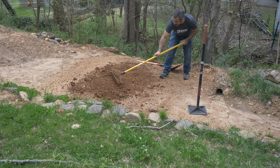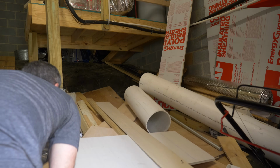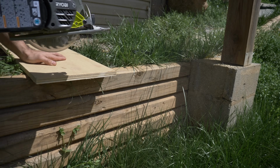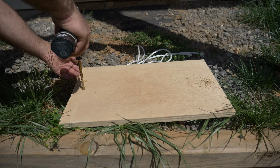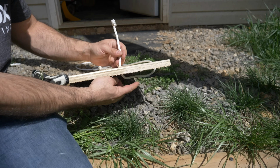Trail builders use a variety of tools to compact soil, particularly when working on jumps. If you need something with a little extra surface area, you can make your own compactor out of scrap plywood. Find or cut a piece of plywood in whatever size you desire, and drill a hole on either side. Take a piece of string and feed it into the holes, tying knots in the ends so it will stay in place.